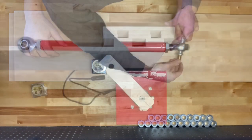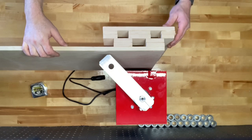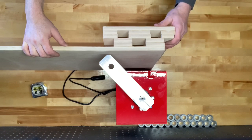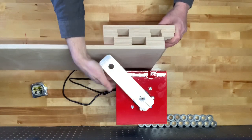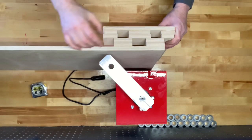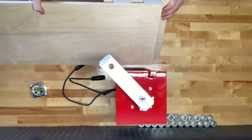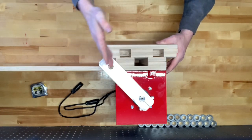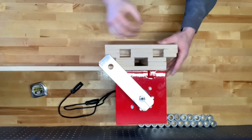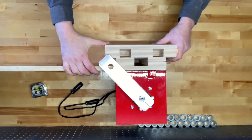Taking a look at the bottom section of the platform, we're using 5/8 inch birch plywood — very sturdy. You can see we've stacked up several layers of it. The idea is that once the bolts come through from the motor cages — we've got half inch holes drilled out of the motor cages — once those go through I need some access points to tighten up the nuts. Very strong and very sturdy. The really important part was to make sure that when this operates it has enough clearance so it doesn't start touching the ground, which is why we built it up so high. I've got another sheet on the bottom as well, which should give plenty of distance and be plenty sturdy once it's all locked in together.